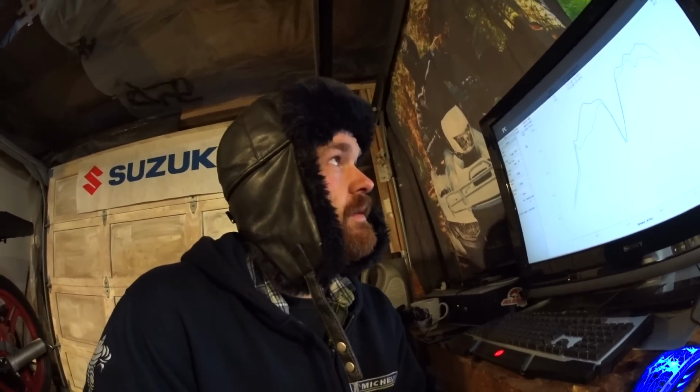because now I'm at 21 degrees, a little bit below peak power, and that should be about, as my lamp showed, about 16 degrees, which is very typical for a powerful two-stroke, 16 degrees at peak power.